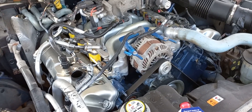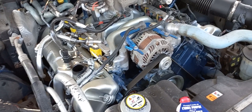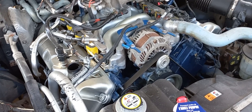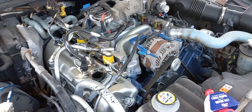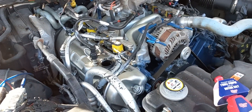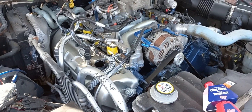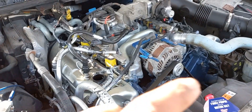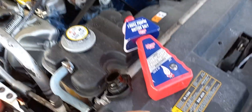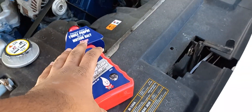What I want to do is clean out the oil. You can use a product like Seafoam, or there are off-the-shelf engine flushes, but I don't recommend using those — especially on an older engine. This car is almost 300,000 kilometers and 6,700 or 6,800 idle hours, so it is fairly high mileage. If it hasn't been well maintained, you don't want to clean off deposits sitting around the rings keeping things in place, because then you might get blow-by.